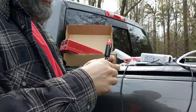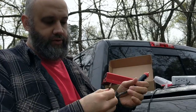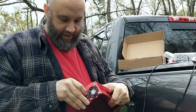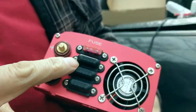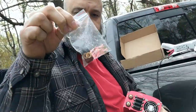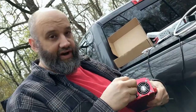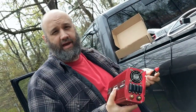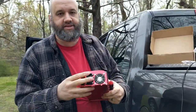It's going to get a small current from the cigarette lighter and input it. Negative and positive — negative, positive — it's really simple, really hard to get wrong. These right here are your fuses — 40-amp fuses — to protect the device. If there's a surge, you'll blow a fuse. It came with a bunch of extra fuses, which is great. 40-amp fuses are a bit harder to find; the best place is a car audio store. Don't use a lower amp — if it says 40, use 40. And don't go 50 amp either.